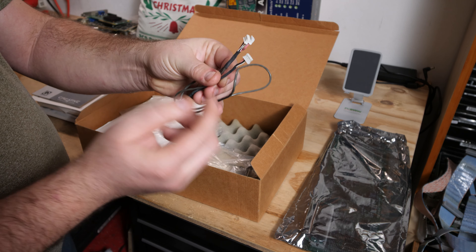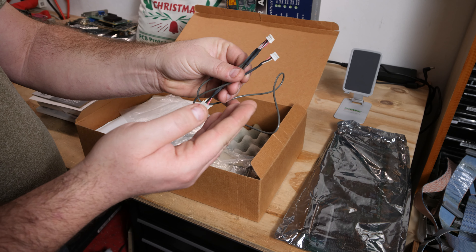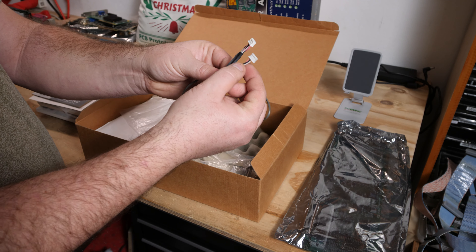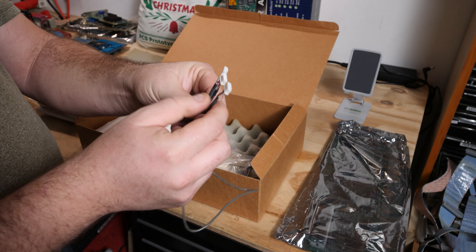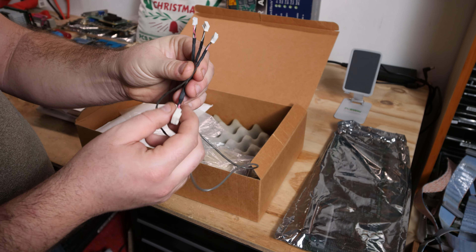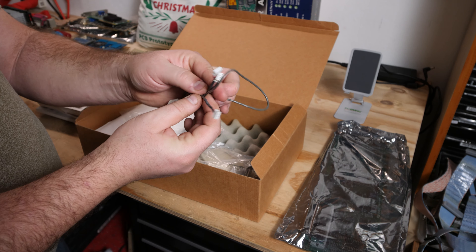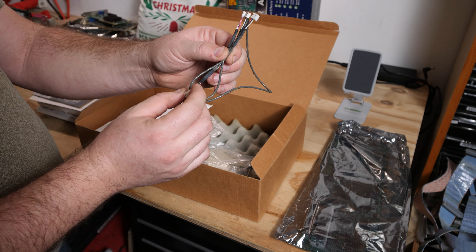Here a cable to connect your CD-ROM player to your sound card so you could play music CDs. The way it worked was that the CD-ROM player played the music CDs directly and converted it into stereo audio. That's why they have three cables — left channel, right channel, and a combined earth. In the early days every CD-ROM player had its own connector type, so that's why they have a multi-cable. In later CD-ROM players they had one standard, so you didn't have to find out which connector matched your CD-ROM player.